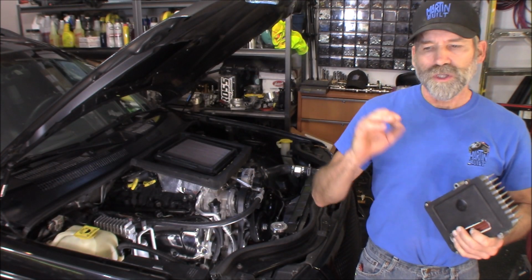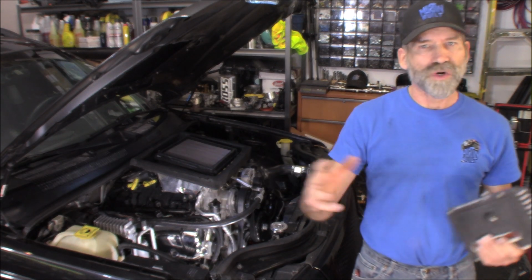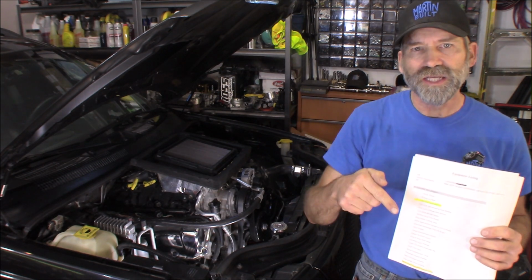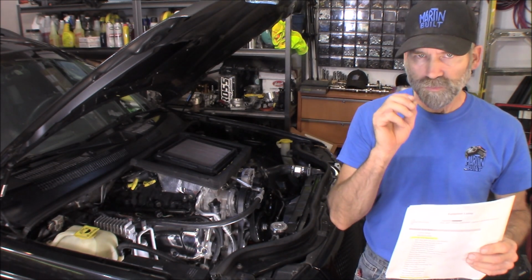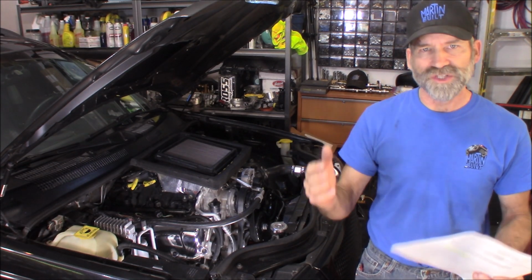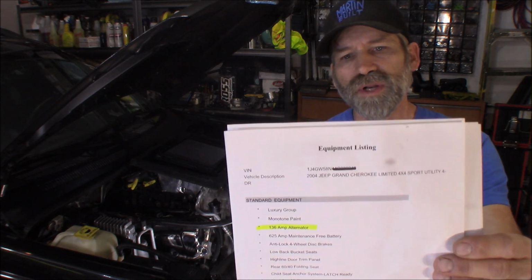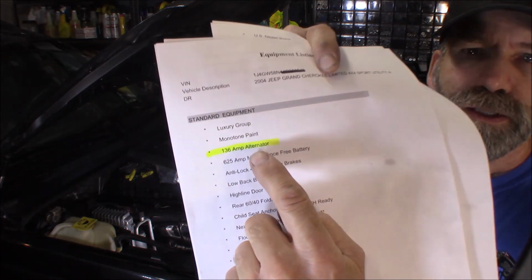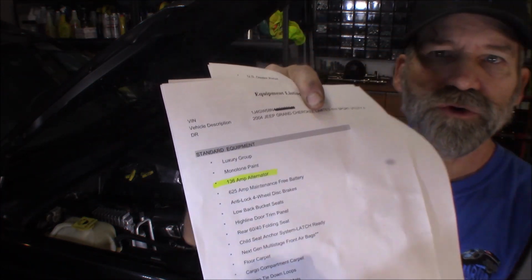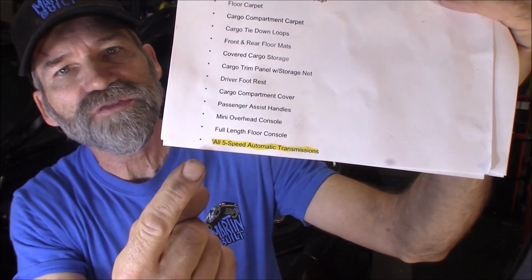Now, if you're wondering what transmission you do have in your vehicle, you've got that question mark. In the description below, I'll put a link to a website that you can put your VIN number in, and this is going to be for all 98 and newer Chrysler products. And when you do that, it's going to punch out a build sheet. It'll start out with the standard equipment, like what alternator came in it, a 136 amp alternator. And at the very bottom of this page, it actually shows that it came with the 5-speed transmission.